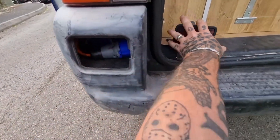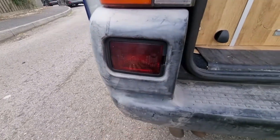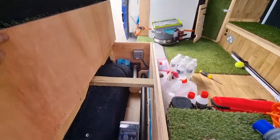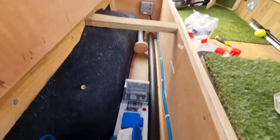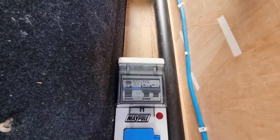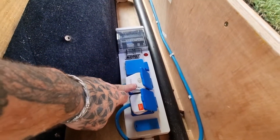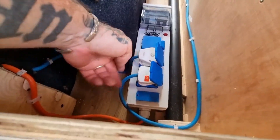I hope that helps - that's how I've done it. There are all different ways. I'm not going to show any of the electrical connections because that's down to you to make sure you can do it safely, or get an electrician to do it. The cables are clipped out of the way. It's fused with a proper 16 amp breaker, plus I've got fuses in each plug as well, so I've got double security running them on basically extensions.